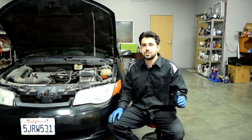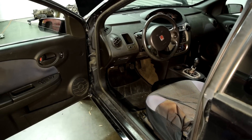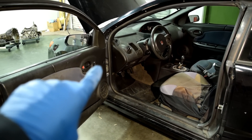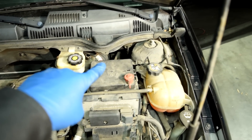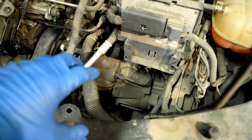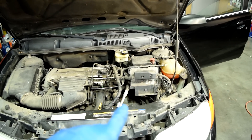Now let's go over how to diagnose issues with your clutch system. First up: a spongy clutch pedal, which may be accompanied by not being able to put the transmission in gear with the engine running. If you have a spongy clutch pedal, you likely have either a failing clutch master or slave cylinder, or a leak in your system. Get underneath and check for leaks where the connecting rod attaches to your clutch master cylinder through the firewall. If it's leaking, replace your clutch master cylinder. Then check for leaks by the master cylinder in the engine bay and follow the line to your slave cylinder. If your slave cylinder is inside the bell housing, sometimes there's an access cap you can remove to check. After replacing any components, add clutch fluid and bleed your clutch system.